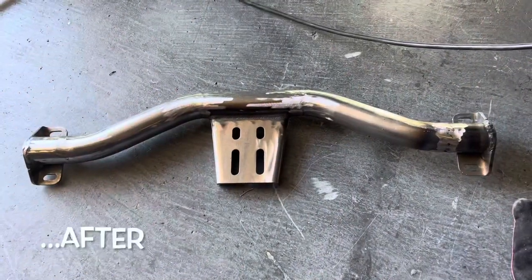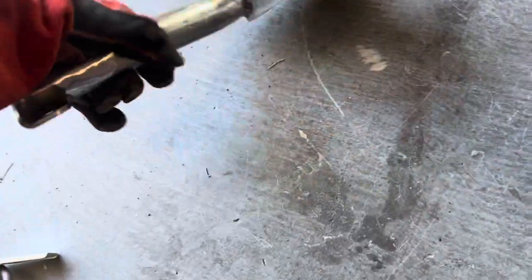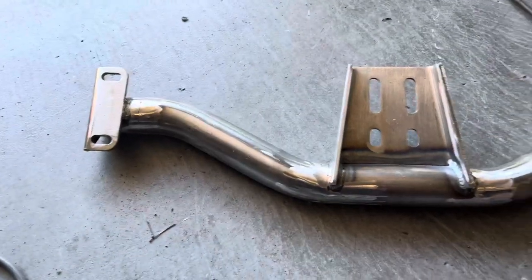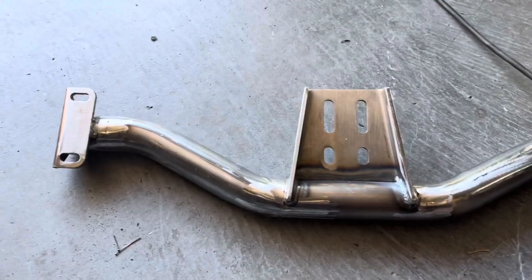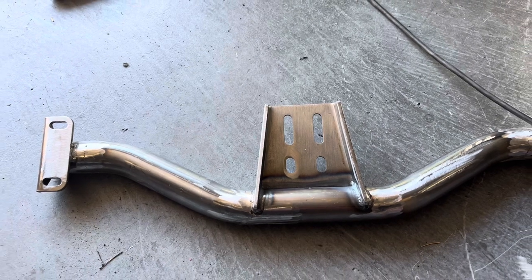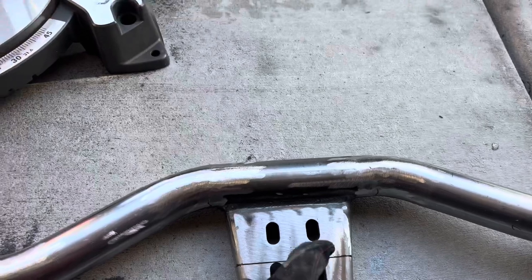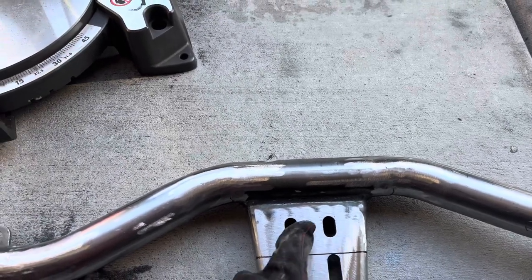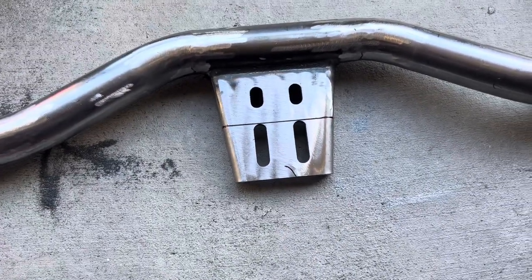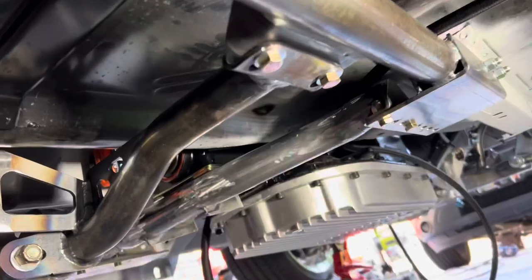It's really not that bad once I ground the welds flush and did a little smoothing out. I don't know if anybody would ever know the difference, except for the fact that I've documented this on video. I'm going to get it in there, see if it fits, and maybe just powder coat it and call it a day. I also realized I don't need all this extra material — it bolts to the transmission mount through just these two holes, so the rest is just getting in the way of where my crossover pipe is going to go. Off with it.